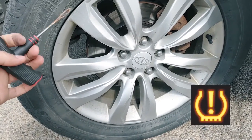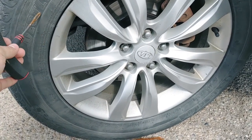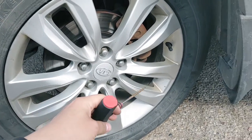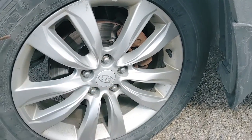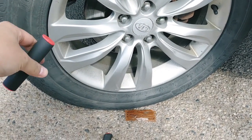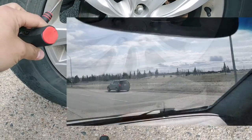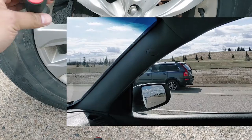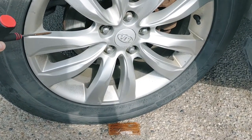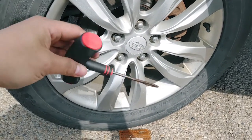That's why you need to have a tire inflator with you in case you ever get a flat tire. If you ever see the TPMS light come on your dash, you should check right away to see if you got a flat tire, then you can plug in the portable inflator and inflate your tire before it gets too low and before you do too much damage to the inside of the rubber — plus you avoid damaging your rim.